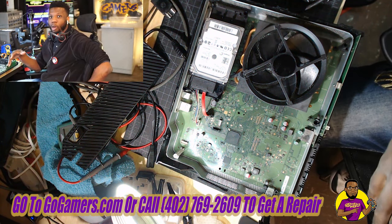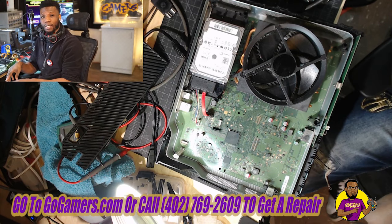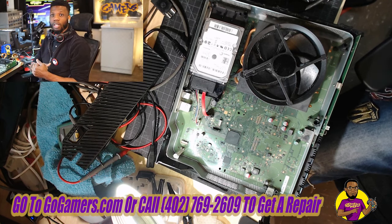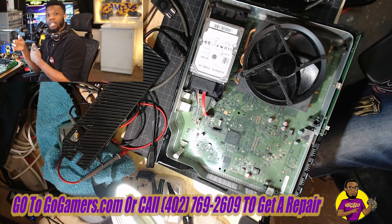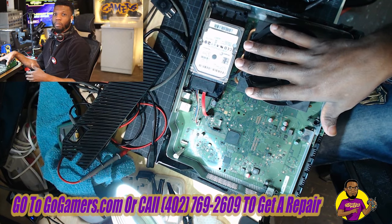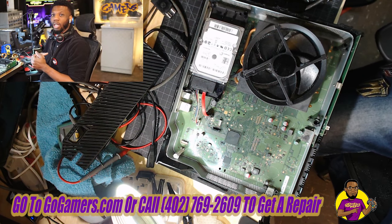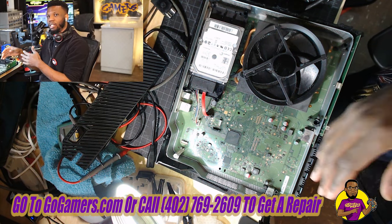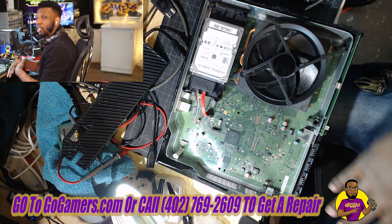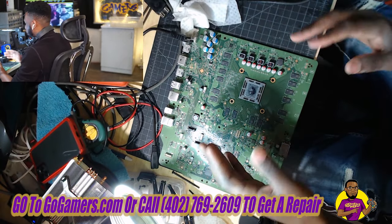Now if the water has been there for quite a bit of time, or if you spilled water inside the game console while it was on and heard a huge popping noise, nine times out of ten that power mosfet is already gone. But if you spilled water while the console was off and you're afraid to turn it on, this is the easiest way to get it out. This console was not turning on at all — they tried to turn it on immediately and it just didn't, because that water was more than likely shorting out those power lines.